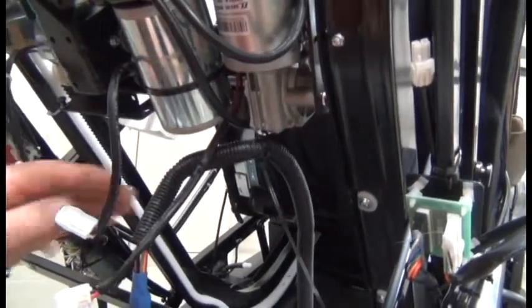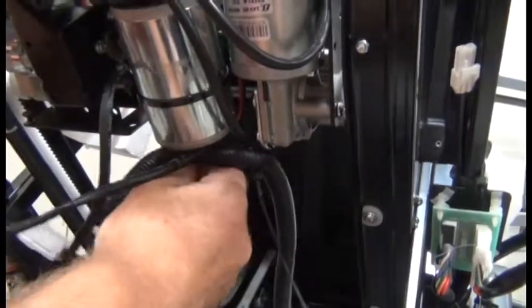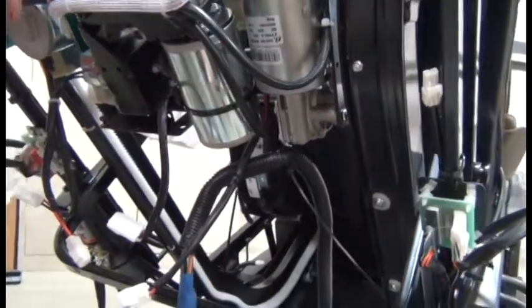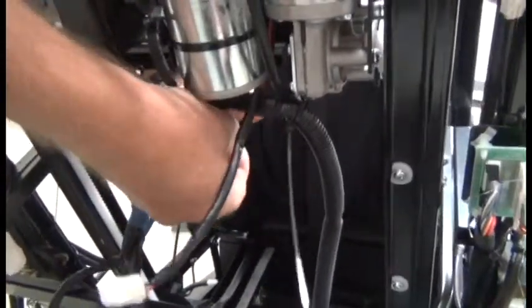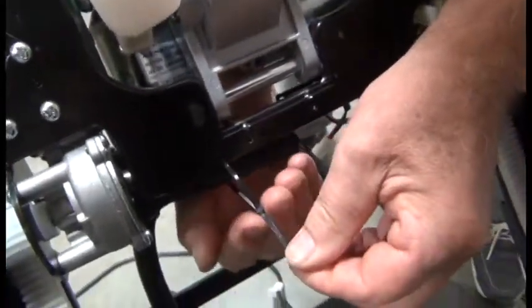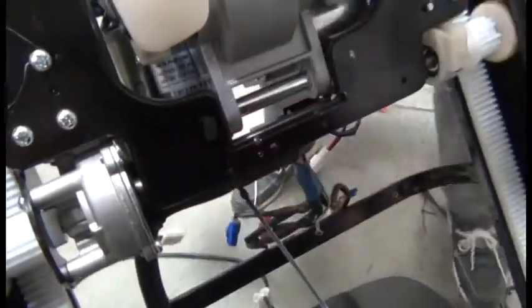And then for the left-hand cable harness indentation, we're going to secure it to a hole in the frame that's located just a bit to the left of where you secured the other one. And we'll take a look at where that hole is on the frame from the backside. It's the leftmost hole in the frame, looking at it from the backside. So once those two zip ties are in place, we're ready to start reconnecting connectors.